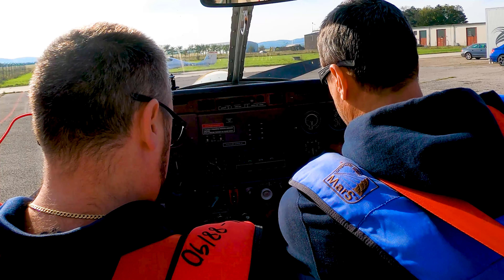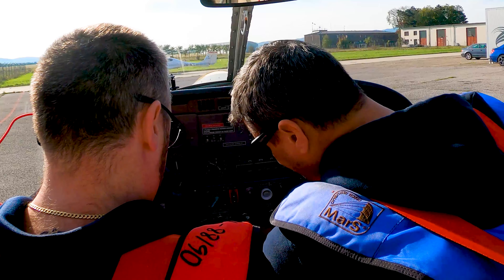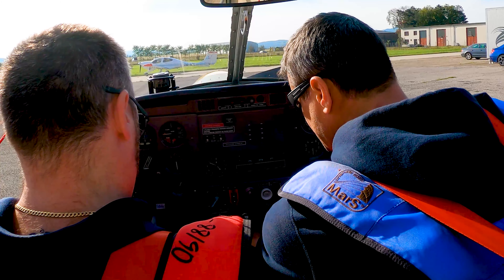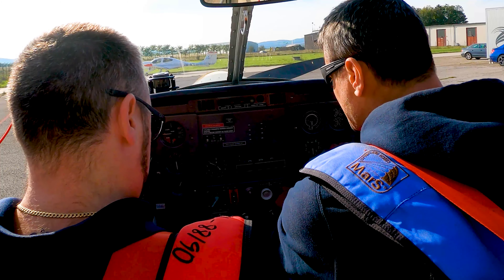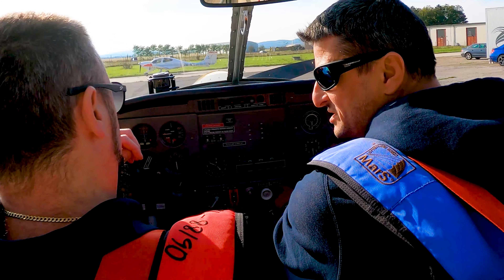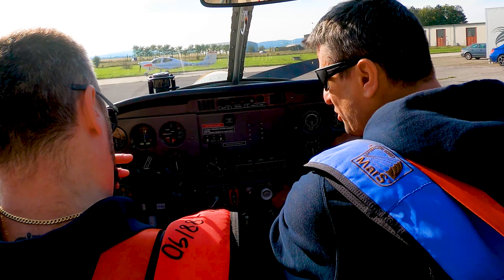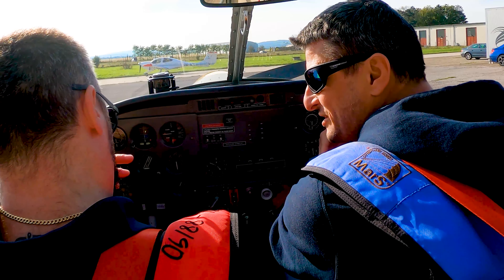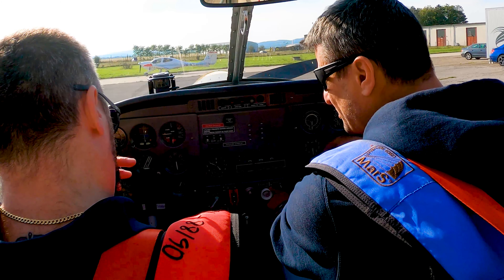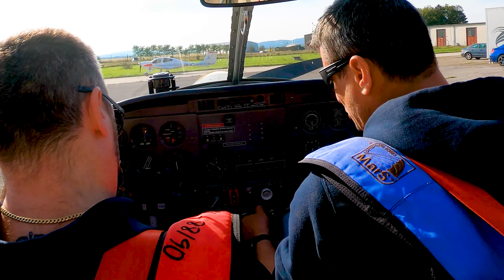This is the supercharger — it must be pushed on for a start because it's also connecting the starter. Here we have propeller adjustment. It's the ventilation. Here is the mixture, but it works in minus. It's a different philosophy from Cessnas. On Cessnas you are controlling the richness with the quantity of fuel. Here you are controlling the quantity of air from the opposite side. So normally it must be in minus — if you give it to the plus, you don't have enough rich fuel.